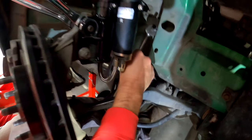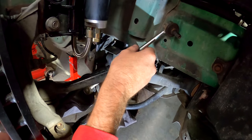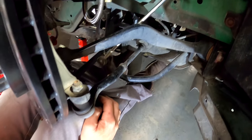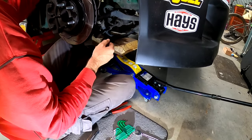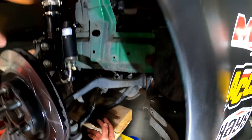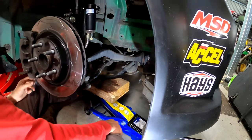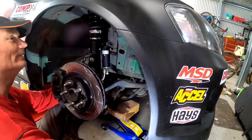We've got a bit of a challenge with our sway bar link - it's a little bit short. We'll see once the weight's on the car whether the sway bar pushes into the right position. If not, looks like we might need a longer sway bar link - and maybe new sway bar linkages and bushes too. We used a block of wood under a second jack to push up the sway bar - a suspension guy would have been laughing at us, but hey, we're weekend racers, not mechanics!